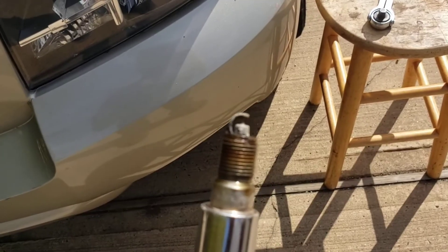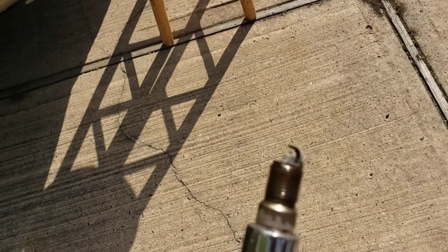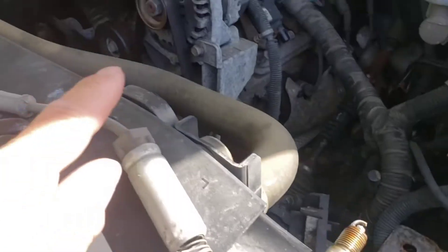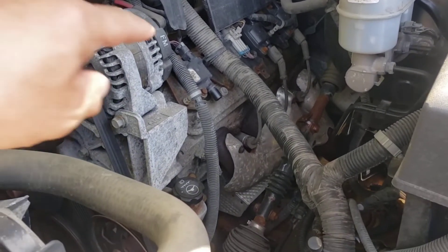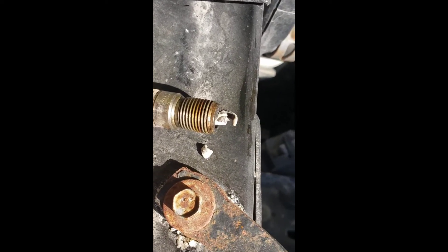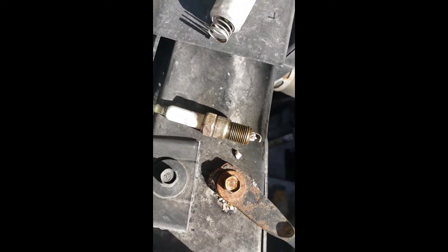Time for plugs, people. Like I said, trying to troubleshoot the misfire — I'm going to take this wire and transfer it with number five, and the coil I'm going to move from one to number three. That's what we're going to do. Yes, it was a crack — I took a little tiny screwdriver, touched it, and it fell apart. Alright, cool. Spark plugs. Bye again — see you next time.